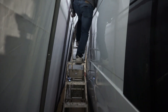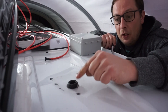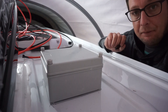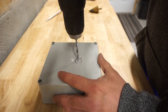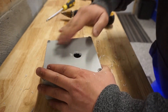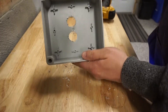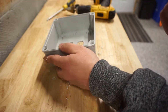Up over one ladder, get to the next ladder, and Curtis follows up. From the front, I already got one hole drilled in. I'm a little limited so I'll set this down on top, go underneath the van, and outline that circle on the bottom of our enclosure. Then I'll take it to the garage, pre-drill a quick little hole in the center, use our step bit and go to one inch. I'm gonna do the exact same thing right beside it for a second hole, giving us two holes in the bottom of our enclosure so our solar panel plugs will fit inside.